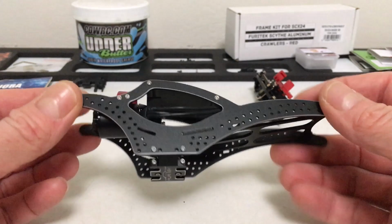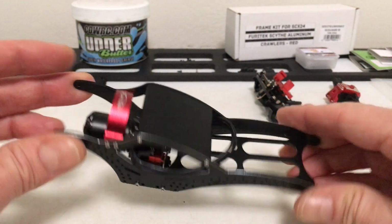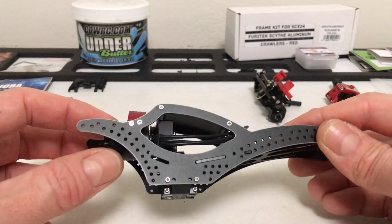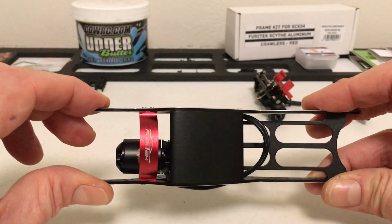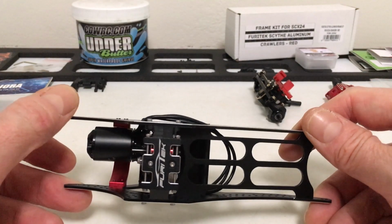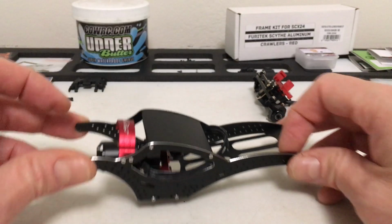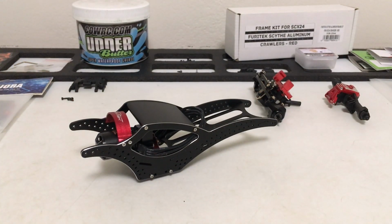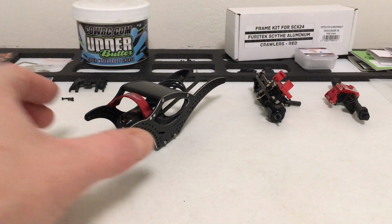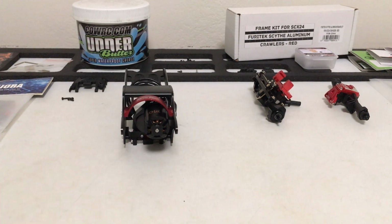But as far as the motor, I think that's probably the direction here. So I think I'm going to pull this whole transmission back out, see if I can clock that motor any better. And then I think I'm gonna get out the electronics, go ahead and bind it and test this motor, make sure everything is kosher. And then we've got links and shocks and axles and tires. So I think this thing is finally gonna start moving forward after this little bit of a motor slowdown, but it's looking good. MOFO to the rescue.